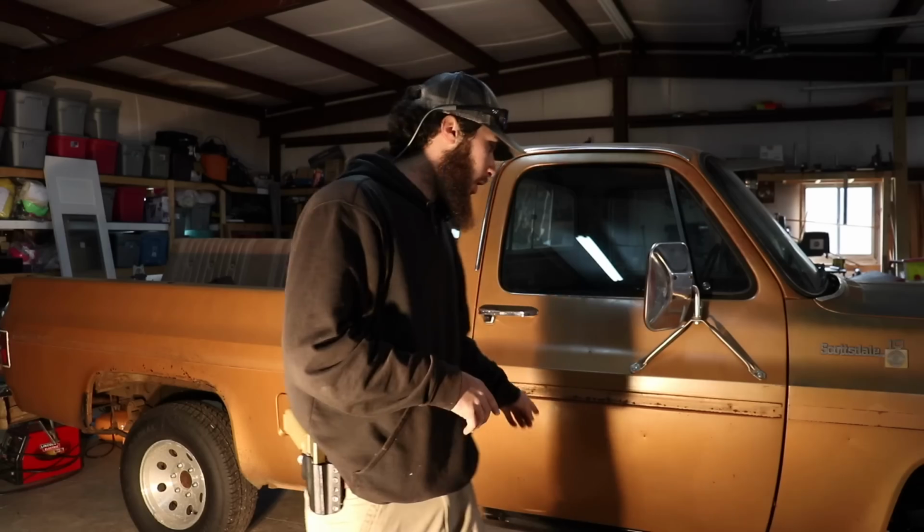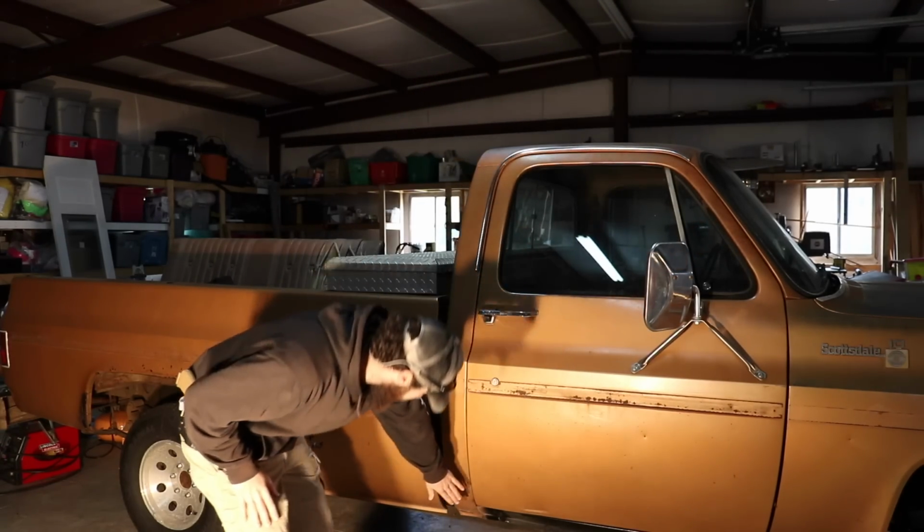We're gonna have to use, I'm trying to explain this to y'all, we're gonna have to use more of the rocker because it's completely bad. So imagine from where it starts to where it stops, it needs to get erased, except like 1 inch on each side. So on this side, we had like 7 inches on both sides. The rocker and the cab corner kind of meet together right here, and because they're both kind of meeting together bad, it's gonna have to get done in order.